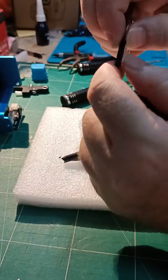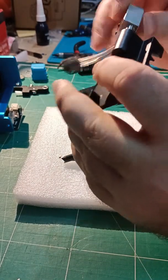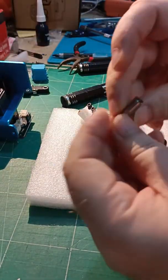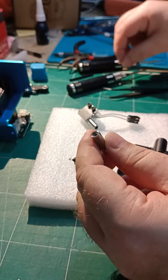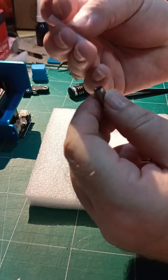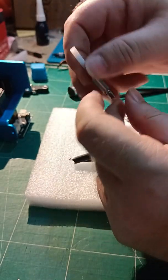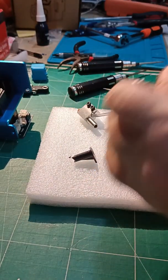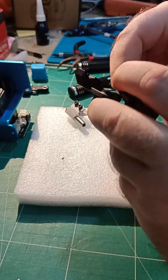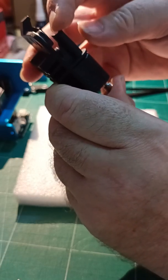In many ways, that's how it sits on a standard setup. With an all-metal heat break, it doesn't go all the way through — it would sit in the top. So we provide a short piece of tube already cut to size, the correct size, to go in the top. As you can see with the cap on, that tube is ready to fit. Job done.